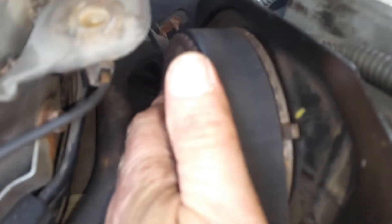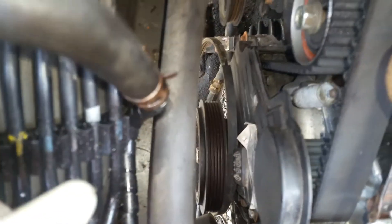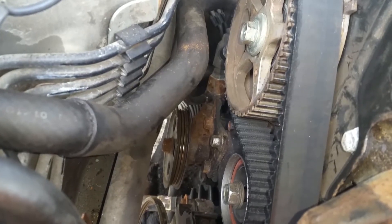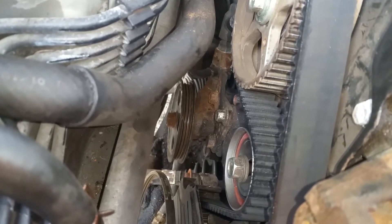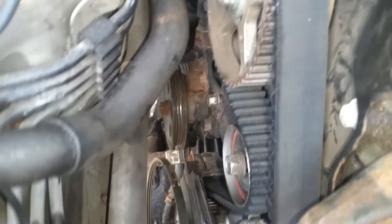I said to myself that dab has to move one tooth up. So I carefully slid the belt off, turned the top camshaft pulley just one tooth, then slid the belt back on. We tightened the tensioner pulley and put the breaker bar back on the bottom crankshaft pulley, rotating the whole thing around to distribute the belt tension evenly, stopping at one and seven-eighths turns.